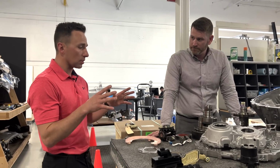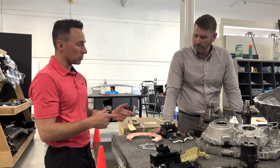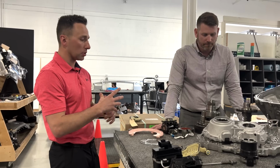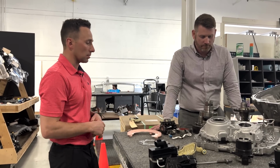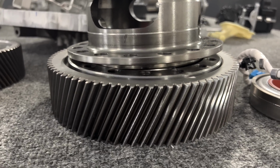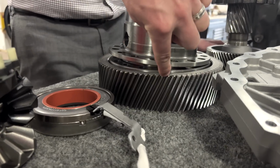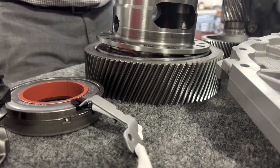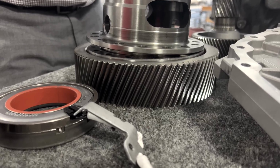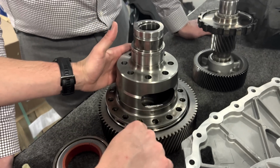And when you're dealing with a vehicle of this mass, the entire system needs to be able to not just manage the torque that it's capable of producing, but also manage those shock load inputs in the driveline coming back into the system, which you can see by the large teeth, not just in terms of the tooth thickness, but also in terms of the spread, meaning across the gear section, how much gear surface area is engaged at any one point in time. That's an indicator. The other thing is looking at the diameter, right? The size of this hub interfacing with that.